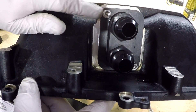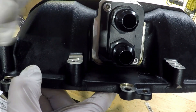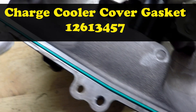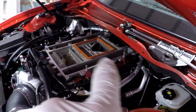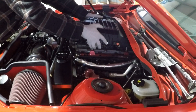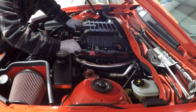These are also 5 millimeter hex - if you're wanting to use those instead of OEM, I'm not sure OEM would work because it'd probably run into the side here. Got the gasket in - make sure it's all indexed properly. Put a little bit of that super lube grease on it just to make it so it doesn't stick, and also put some on the brick gasket there, just along the top. Got the bolts hanging out of the back there, which makes it a little easier to install so I'm not trying to find the bolt holes.